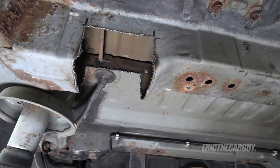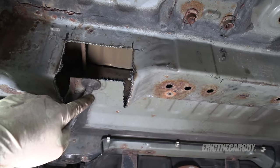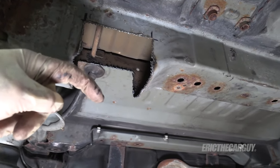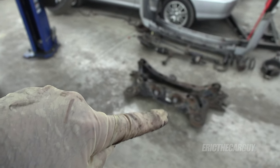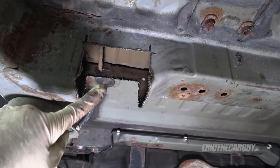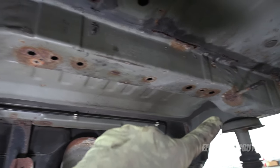My plan for the rebuild is as follows. I'm going to start by cutting and welding in a piece of metal here to replace this empty space. Then I'll get a piece of metal to cover this area, drill a hole through it, and drop that piece I just cleaned down into it in approximately the right position. Then I plan to take the subframe, bolt the new bolt assembly to the subframe, and bolt it all up in here — all four bolts. That way this will rest and land exactly where it needs to be, and from there I can tack weld things into place so I can build up around it, ensuring everything winds up in the right place just like the other side.